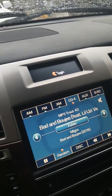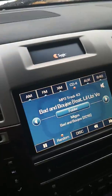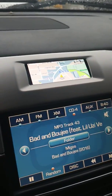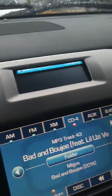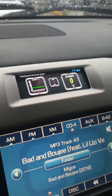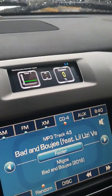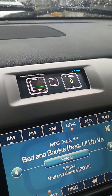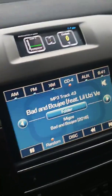I have a couple animations when the truck first starts up, and then it will take us to CarJack. Down here in the OBD port — it's kind of hard to see because it's dark right now — I've got a little Bluetooth adapter. With that I can actually run the Torque app on Android and get real-time stats from the computer. It just takes a few seconds to connect, and right now I just have a temperature screen up, but basically anything you can read from the computer you can display on your screen.